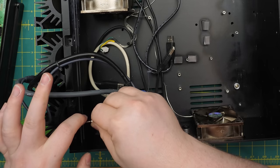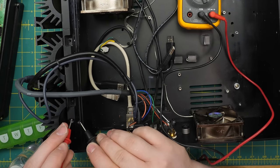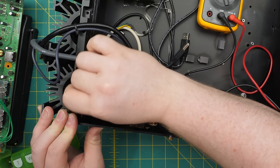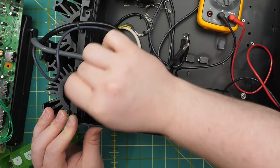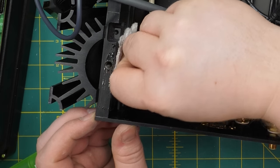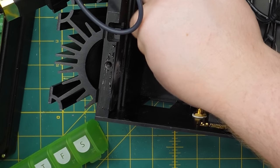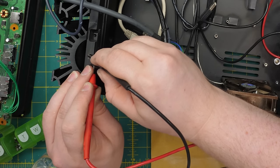I should mention, the reason I'd had the sandpaper on hand was to help with grounding the chassis. There are a bunch of unused bolt holes in the heat sinks, and I figured I could attach a ground strap to one of them, but I had to take the anodized surface layer off first to make it properly conductive. I just used the sandpaper to scuff up the surface around one of the holes, made sure I took it all the way down to the metal, attached a ring lug, confirmed I had continuity. It's ugly, but it works.